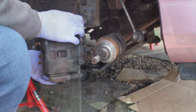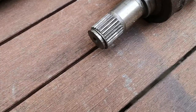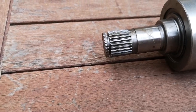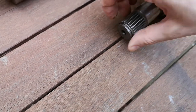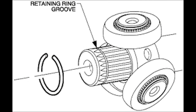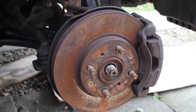Unfortunately one thing I neglected to do was to replace the circlips. On this side this driveshaft actually lasted longer but eventually it did go. The circlips are between £5 to £10 from Honda - they're only intended for single use. You can see here what happened by not buying new circlips - it just chewed up the end of the driveshaft where it popped in and the circlips were a bit loose. I ended up going through five driveshafts on one side. It's just worth replacing those little circlips - it only costs a couple of pounds and will save you a lot of hassle down the road.